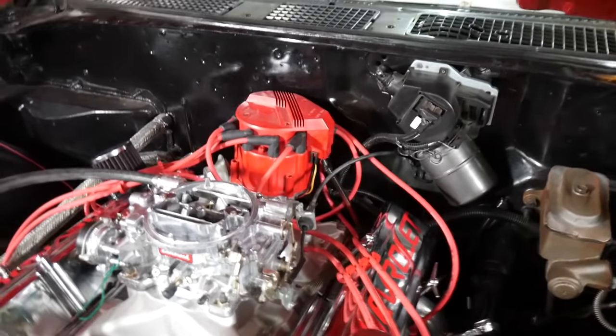Oh yeah, that's nice. Well, no surprise, this slid in perfect. I mean, fits right on the money. And the Chevelles that came with extra cooling, those were the ones with the wider radiator. If you had standard cooling or non-AC, that was a smaller one. And there's little rubber cups or C-bushings down on the bottom here. You just slide them out to the next one and she pops right in.